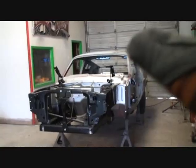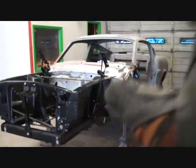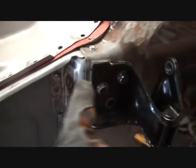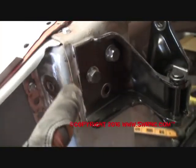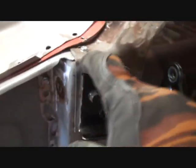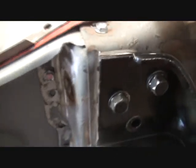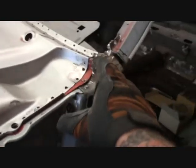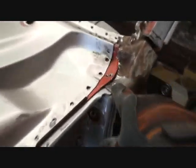We are now at the stage where we can start welding all this together, and hopefully it's going to turn out to be a nice car. The first thing we need to do is remove this top hinge. If you notice real close, you can see I took my air angle grinder and I ground a notch down there and right here. Once I remove that hinge, I'll be able to use these holes to line everything up, because we've got to take that piece out of there.